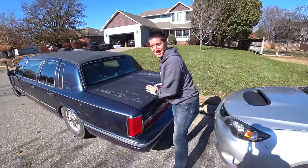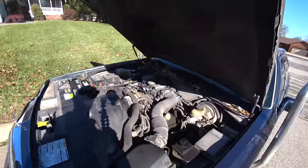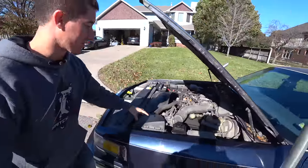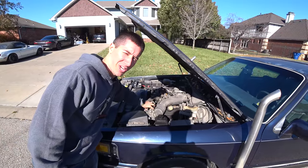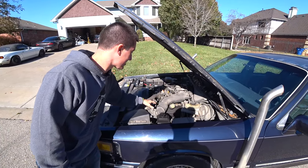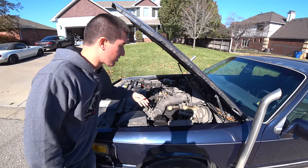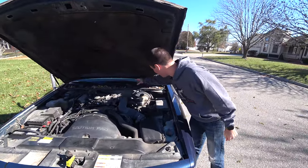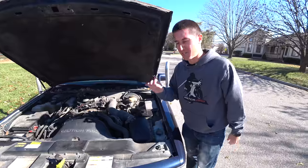I think the trunk used to shut better. Getting the hood open on this bad boy. Our game plan for today is to change the air filter, clean the mass airflow sensor, and swap out this coil pack, which I think is the culprit. It drives two of these cylinders, so it's probably that coil pack. I'm also going to grab a broom and try to sweep all the trash out of here, just to clean it up and keep water from sitting in there.